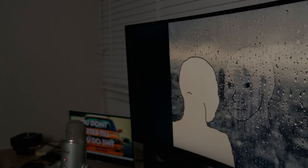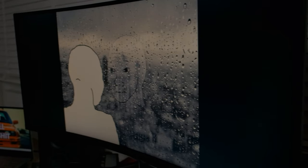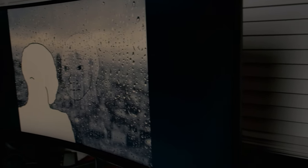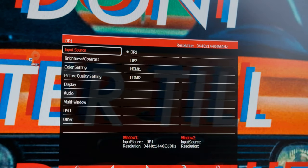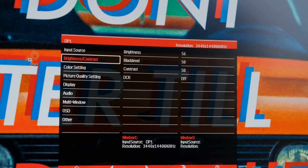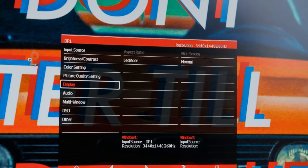At the back you'll find the I/O: two DisplayPort 1.4 ports and HDMI 2.0. It's heavily recommended you use DisplayPort 1.4 because that's how you get variable refresh rate and all the functionality you paid for. Using HDMI 2.0 may cause problems with G-Sync and FreeSync. A DisplayPort cable is included in the box, so it's clear they want you using DisplayPort for the full experience.